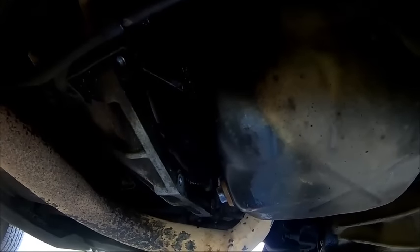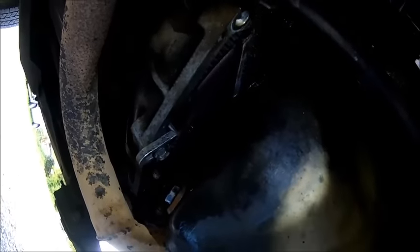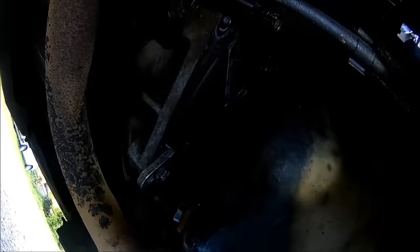It turned out all the bolts were loose between a quarter and half a turn, perhaps a little bit more on the last one. So that explains the rattle. I think I'm lucky — I can't see any cracks in the flex plate. I'm going to loctite the last one as well, just to make sure they all got loctite on them. Then we put it back together and give it a try. All four bolts got loctite applied, torqued up — now get the flywheel locker out, put the inspection plate back and see how it sounds.